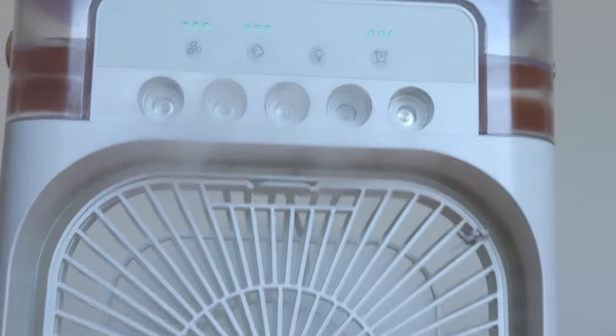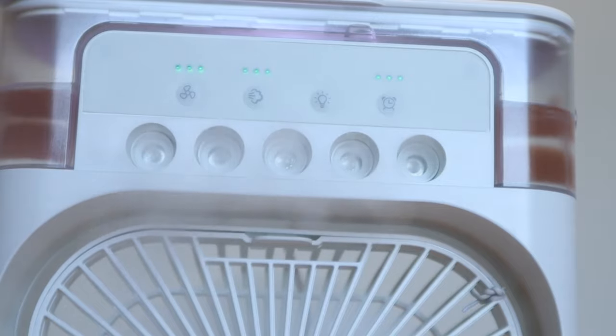The Nexfan actually has a filter, but one thing I made a mistake with on the Nexfan is that UK tap water comes with limescale, and the limescale has built up in the tiny hole that feeds the mist. So I can no longer use the water spray on that one because the limescale blocked the hole. The NTMY has five large holes projecting out, so we shall see how long those last.